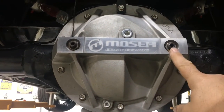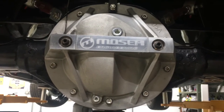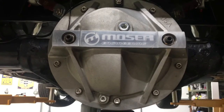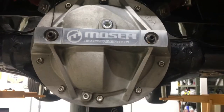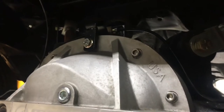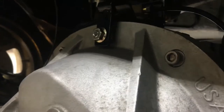These guys here are set against the bearing caps and torqued very specifically. The only thing I would complain about — which really is not a big deal because it was a reasonably priced cover — was that these cap head bolts came in a mild steel, which surface rusted pretty quickly. So I went down to the hardware store and bought some stainless ones. The other thing I had to do was make a little altered bracket to hold the brake T distribution part. I put a stud in there with a bolt behind it torquing it, so the cover is still doing its job and I'm using the stud to mount that.